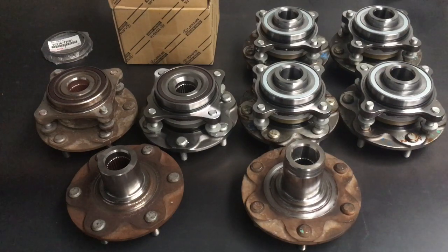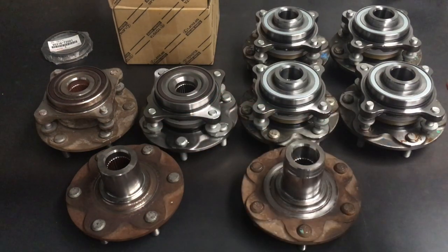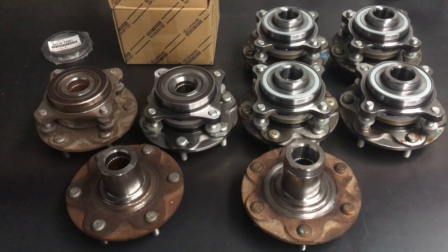That saving option isn't available on the Prado - the Prado's got the sensor in the bearing, it's a different bearing. So you can't just mix and match all these parts and hubs - they're all different. The only things that are kind of the same are the bolts, the o-rings, and the seals - three seals in total and the bolts. But they're not exactly the same because there are different part number listings. We use what we see as the best parts - I don't care if it's a Prado part number on a Hilux if it's available.